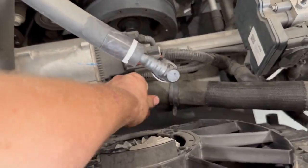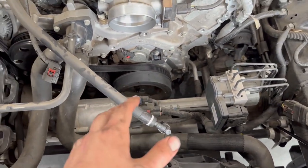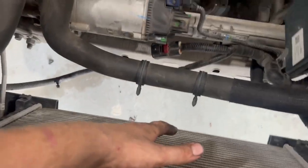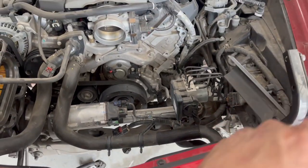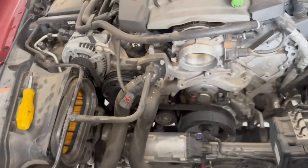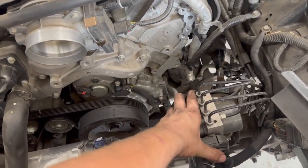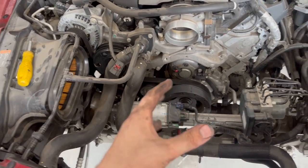We've got our clips pulled off the radiator hose. Now what we're going to do is remove the front sway bar. I went in and took the e-fans out to give us more room to work. Took the sway bar off, took the wheels out. I'm about to pull the rack out of here. I've got the steering shaft off and the tie rod ends off, so now I just have to remove this little module from the rack and take the bolts out.